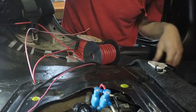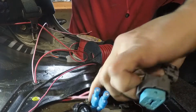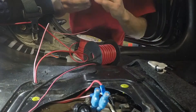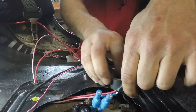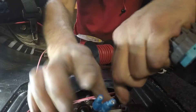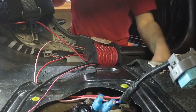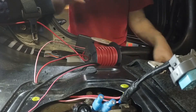I like to do it one at a time. Since these two legs are going to be my activation wires, I'm going to tape them up with black tape and get them out of the way, run them underneath so they don't interfere with anything. Then I'm going to get a self-tapper and make a ground area. I want these wires taped back far enough so they don't interfere with the fuel lines when you install or remove the pumps later. Red is power to the pump, purple is activation.